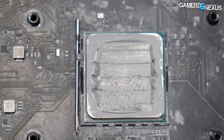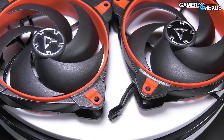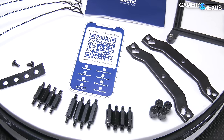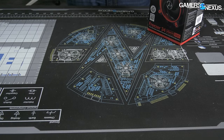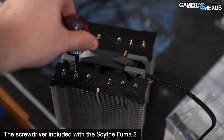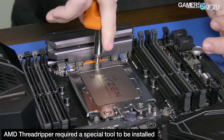The cold plate of the Esports Duo lines up, but it doesn't cover the entirety of the CPU's IHS — especially for Alder Lake or AM4 CPUs. It just means you have less surface area contact, affecting efficacy somewhat, but not in a way that makes it unusable. The documentation and packaging is adequate but nothing special. Our cooler arrived with all hardware listed in its manual. It doesn't include a screwdriver — our staff is split on this. Some prefer no included tools since we already have a drawer full of duplicate Allen keys, while others want it to ensure you have the right tool. Either preference seems fine — it reduces waste, but not everyone has all these tools from previous purchases.